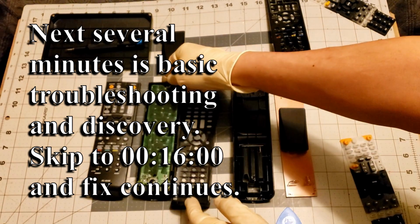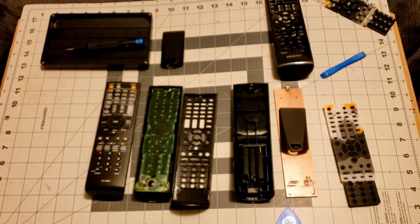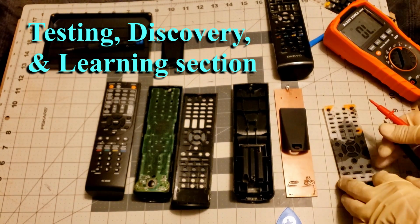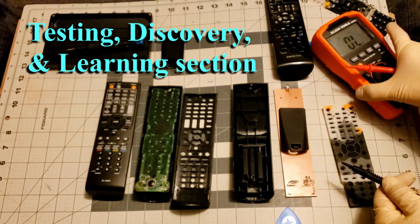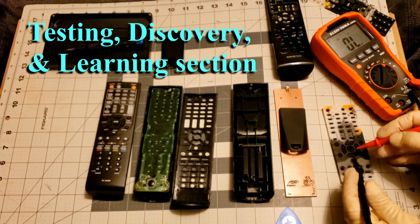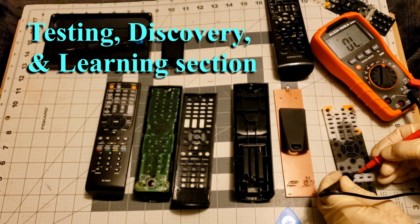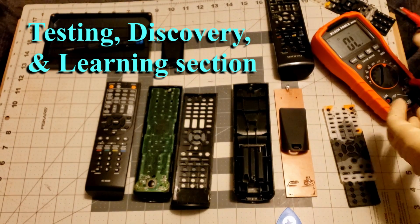Okay, let's do one other thing. See, so I have a meter here. Now we're going to put it on continuity. Continuity is basically put it in here and you get the signal that you got contact. Okay, so just to verify if these strips have some kind of coating, let's see. No, they do not. So it's kind of weird that when they press, somehow it creates a contact.